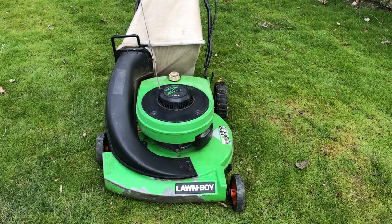So I teased this mower in my 100 subscriber special, and I had said, if you listened carefully, that I had completely rebuilt the engine on this mower, and that is true. I did it myself. I completely rebuilt the engine: new piston rings, new top and bottom needle bearings, new top and bottom crankshaft seals, and it's all regasketed. I filmed that video, but unfortunately I lost some of the footage and my video editor collapsed and deleted the rest of it.